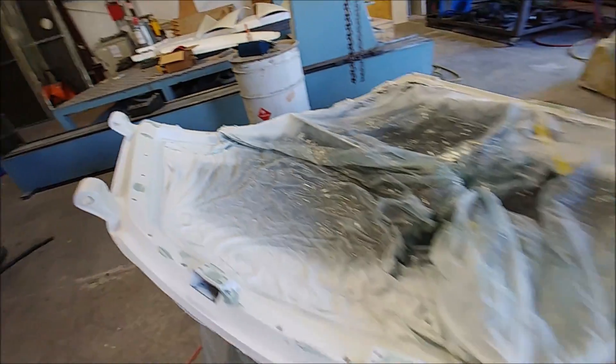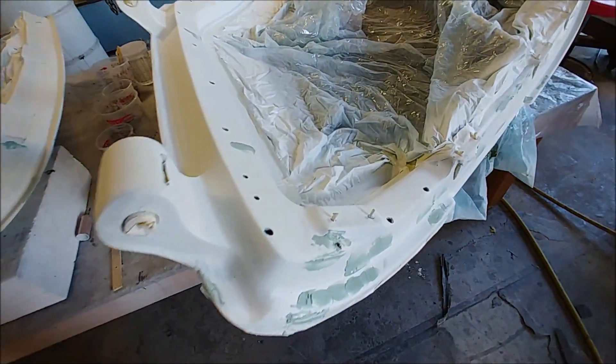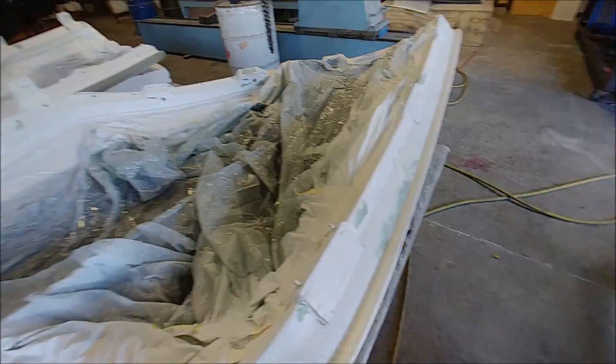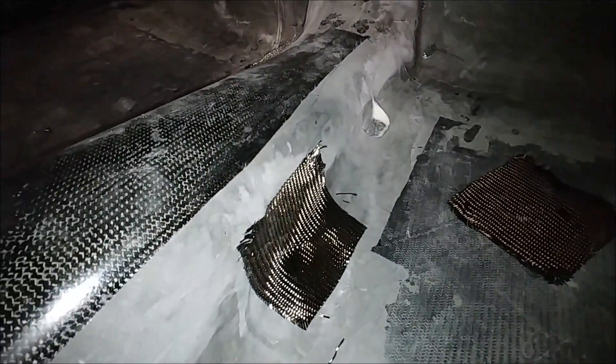Here's me making progress just patching all the little pinholes and problems on the doors where various things have been done and need to be patched. Meanwhile, I also had to notch out where the seat mounts for the rear seats go, into where we did that radius blocking a while ago, and there's the carbon fiber I'm going to put in there and do those layups.